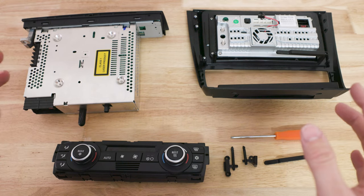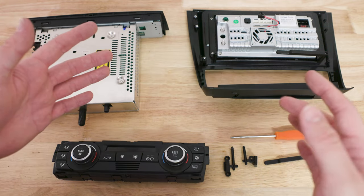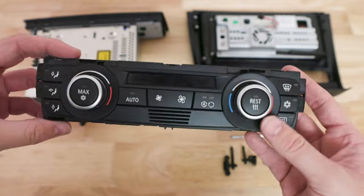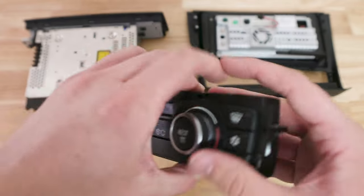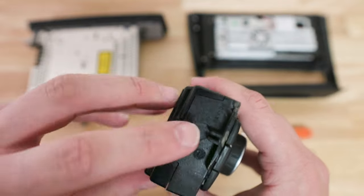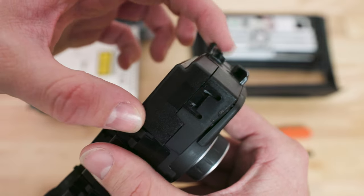My first tip is to make sure you construct the frame first before plugging in the wires — I've already made that mistake and I'm filming this in reverse. The good news is this is a fairly easy install, it's all pretty self-explanatory. The bad news is there is some cutting. These little tabs on either side don't fit because of the repositioning, so we're just going to dremel off this little edge about halfway through — just cut between here and here, leaving the bottom part.